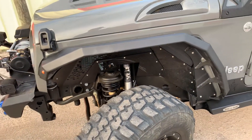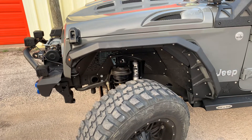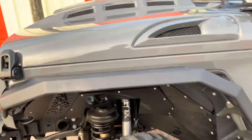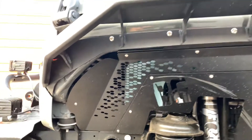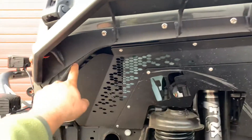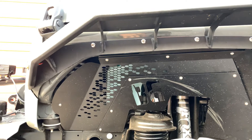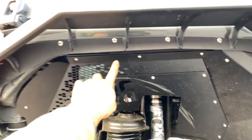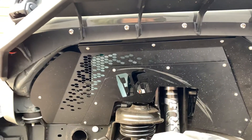Here is the Jeep that we have installed them on — you can see it is the fender and the inner fender, front and rear. Everything is pretty solid made and came together pretty well. I will say that the instructions don't talk about cutting any brackets. There are two brackets here and two brackets up here, and those brackets have to disappear. You're going to have to cut those off and grind them down, or the three different plates that go in here to hold the inner fenders and attach to the fender are not going to fit.